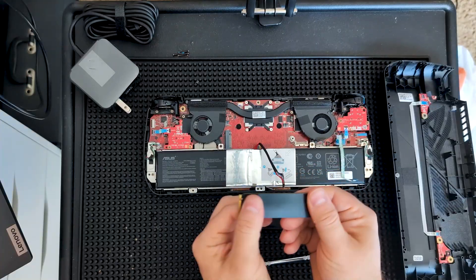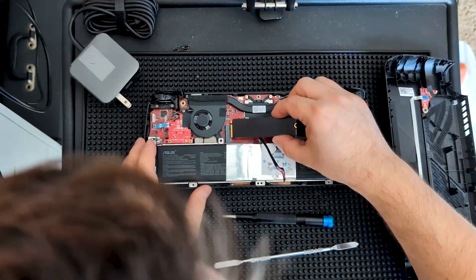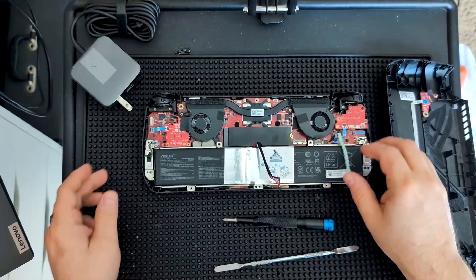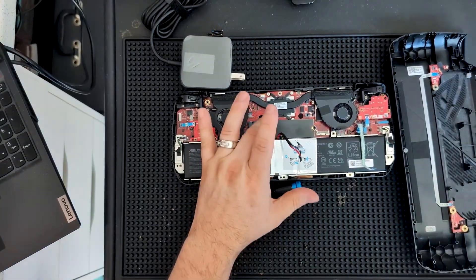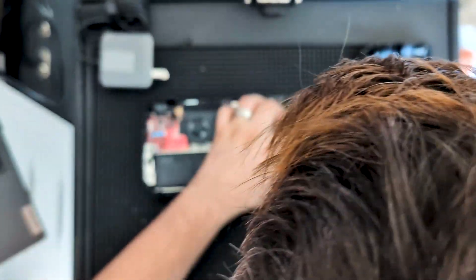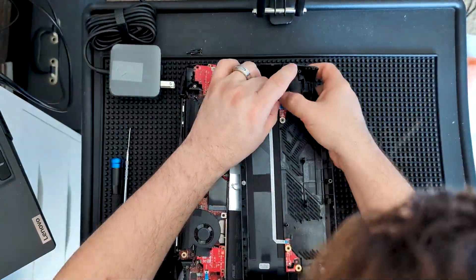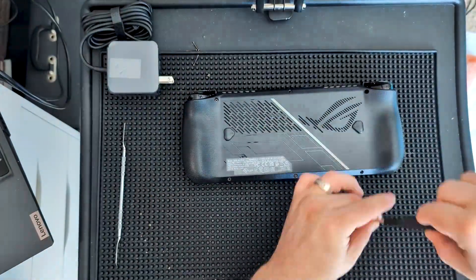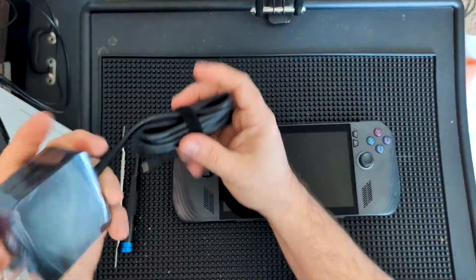If you know anything about SSDs, the controller difference might matter to you - I tend to like Phison a little bit better. Here's the four terabyte new SSD. I'm going to put the stock thermal sticker on there so it looks like it hasn't been modified if someone takes it apart. This is easily slid into place at about a 45-degree angle. This is a four terabyte SSD, which is possible because we're using a full 2280 SSD instead of the 2230, which has traditionally been in a lot of popular handheld PCs. I don't like 2230 SSDs because as of now they kind of max out at two terabytes.